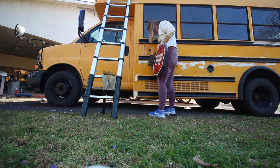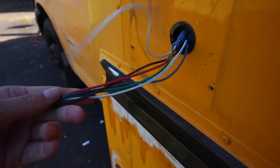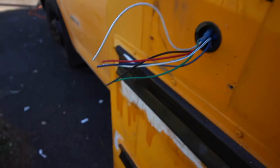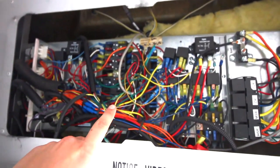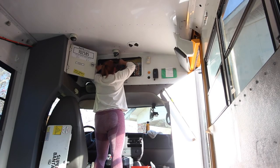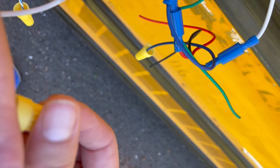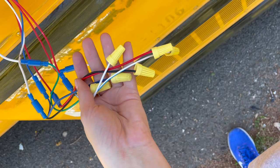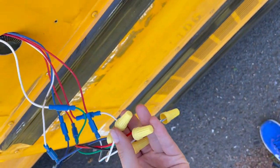There's a lot of wires. When I pulled that panel off, there were all of these wires behind it. I need to go find the other end of these wires and disconnect them from the electrical box up in the front. We found one of the wires — they're all marked ST arm, stop arm. It's going to be a slow process to find all of them, but I know what I'm looking for. Now that all these wires are capped, I'm just going to shove them in here and seal this hole up. I'm still going to try to find the other end in the electrical box — I found two, but I'm still missing a few — so I can officially disconnect them and they won't be live.